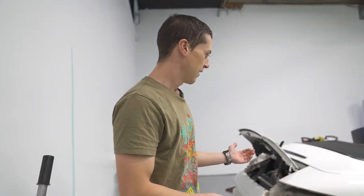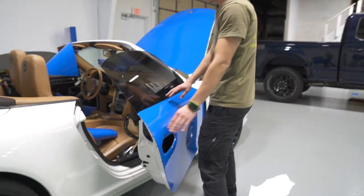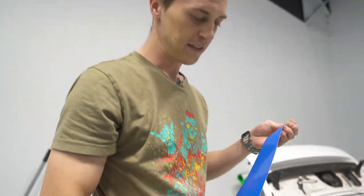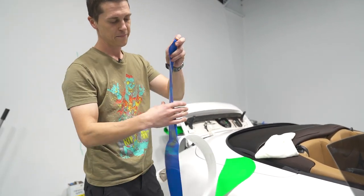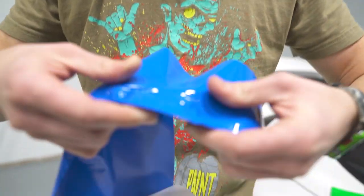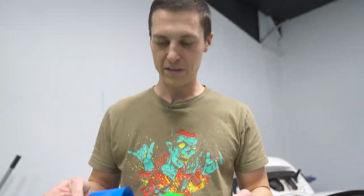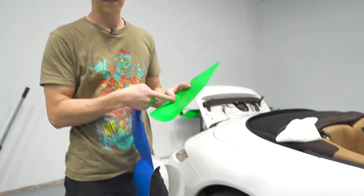We've also got the 2006 Porsche 911 Carrera which we just disassembled — it's white and we're putting Avery Dennison gloss blue film on it. I'll show you the difference between the two films: the Hexis film that's laminated versus the Avery film which is not laminated. This Avery film you can see how it stretches — it's pretty thin. Versus the Hexis film, it's almost like paper, super thick, no stretch whatsoever. The difference in thickness changes the install quality quite a lot.